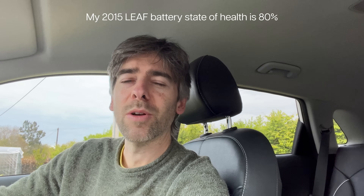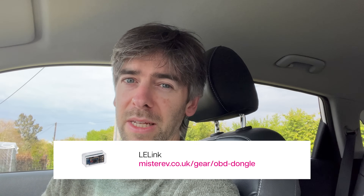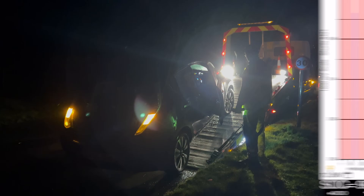If I plug the dongle into the Nissan Leaf, that's much less than 100% — it's an older car with pretty awful battery management, so that's kind of to be expected. Leafs are notoriously poor for battery management. But that brings me to the Leaf, because with the Leaf you can get even more information if you download something called LeafSpy. LeafSpy is a bit touchy about which OBD dongle it likes, so I have a separate OBD dongle just for the Leaf called the LE-Link. Really good information, including whether a battery cell is dodgy.